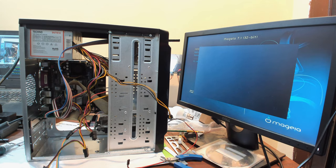And the Linux kernel does, like, you can build and boot the Linux kernel on an i486, even the non-DX one, so you can have a fake FPU and stuff like that, but it doesn't really work on a regular 486. It needs a 486 DX. 386 support was very, very recently removed. I don't know if any LTS kernel still has support for it, but I am very doubtful of that. So 386s are out of the question, but 486 should still boot.